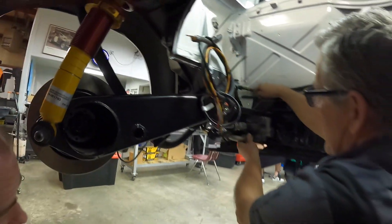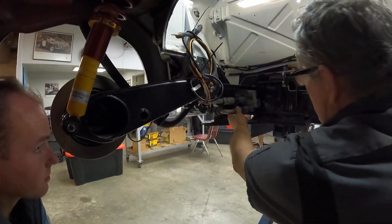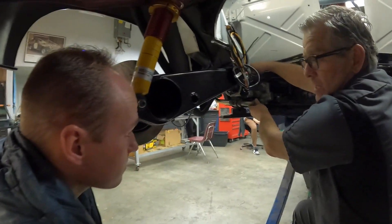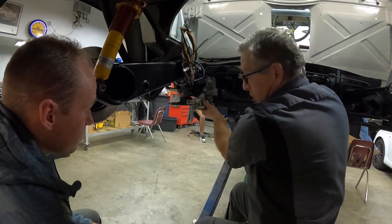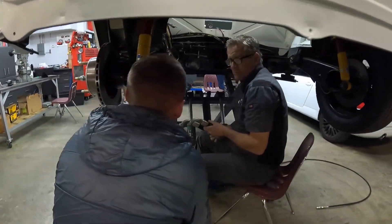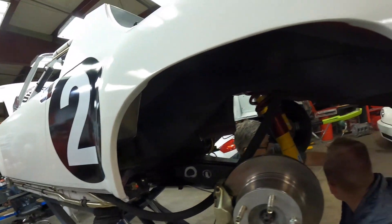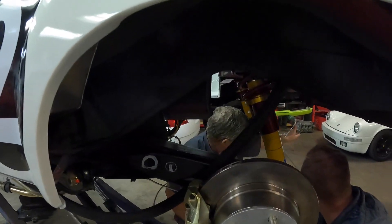This line goes into there, and this line comes over as the exit out of the motor. It comes in — if it's not hot enough, it just goes like this and back into the tank, filtered, dumps in the tank. Once this opens, the oil goes all the way up, travels to the cooler, all the way back, through the filter and into the tank. The system should end up at about 12 to 14 quarts.